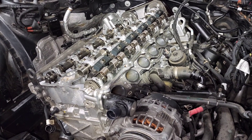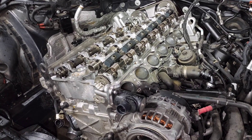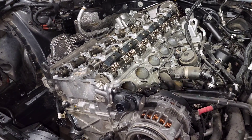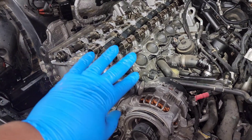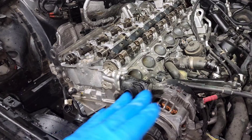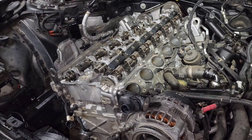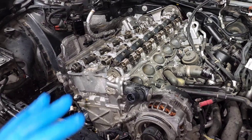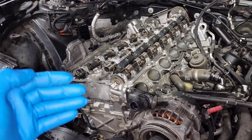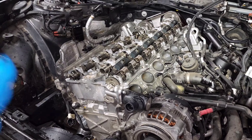This is really good for emissions because crankcase gases contain fuel vapor, oil vapor, and water — things you don't want venting to atmosphere. By running them through the engine they get burnt off and come out clean through the catalytic converter. The downside is that this location on the PCV sees boost pressure, so when the turbo is generating boost, that pressure can go backwards through the head ports into the PCV and pressurize the crankcase. A check valve in the valve cover is supposed to stop that, because pressurizing the crankcase can cause misfires and piston damage.